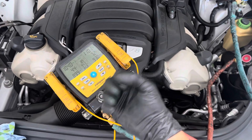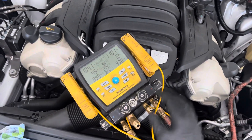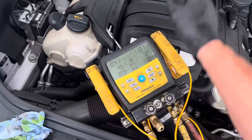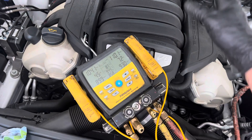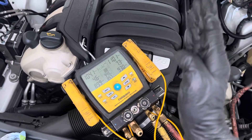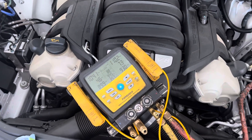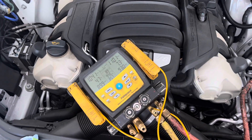So if you used one of those little cans and hooked up on the low side on a fairly warm car — say 80 degrees, car running — and you saw only 65 psi on the low side, you wouldn't know it might be 140 psi on the high side. You wouldn't know that because it has a hard shutoff expansion valve. You might think it's low. If you're taking static pressure, do not use static pressure as an indication of whether your system is charged or not.